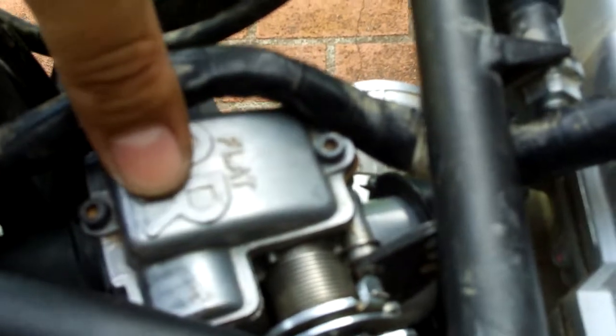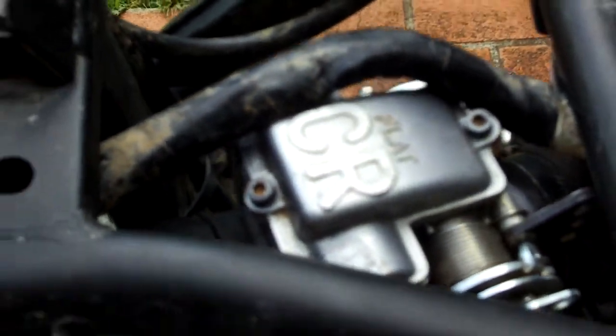I think I'll need to take off maybe seven millimeters. I tried to fit the tank and it's sitting on top of the carb, so it won't seat properly at the back. That's another indication that the spacer is probably too long. Time to take this off again and see what we can do.